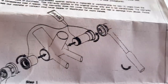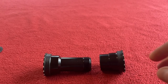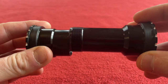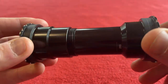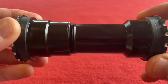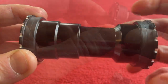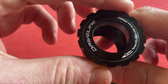A little bit of grease on the threads — I'll be putting a cup of grease on those and then fire it in. Drive side gets the big one and the non drive side gets the little one. Put them together, make sure the threads line up and tighten to 25 to 30 newton meters, which is tight enough so it doesn't move.